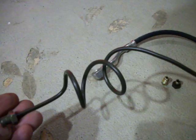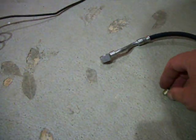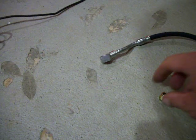I had to get it all squared away so that when I bent up the lines and bought the flex lines to replace everything, it all fit correctly. It's relatively interesting that an English 3/8-24 will fit in an M10 1.0, but the other doesn't work. It's a little bit sloppy, so the torque specifications won't hold — you'll strip the fastener out if you attempt to put a 3/8-24 into a female M10 1.0.